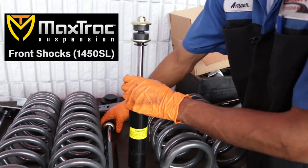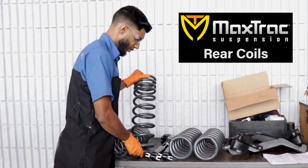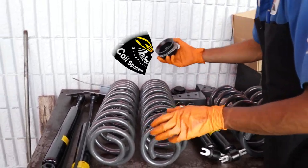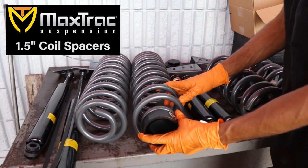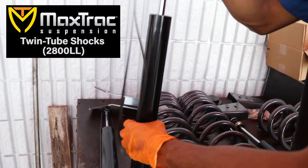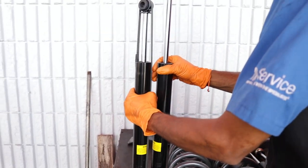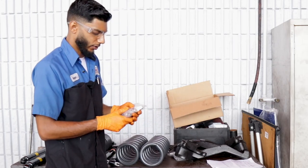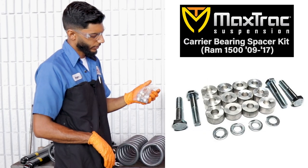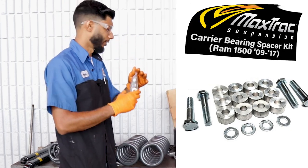These are our front shocks. Here are the rear coil springs — this is going to be the bottom plus the coil spring spacer that we're going to put on the bottom; those are just going to sit just like that. This is our rear shock — I have one extended here so you can see the travel. Since we'll be lifting the truck, we have to basically lower the center bearing on the driveshaft because we need to get a correct angle — you don't want a tight angle at the center of the driveshaft.